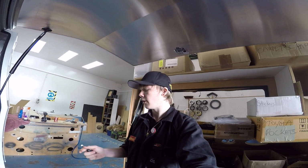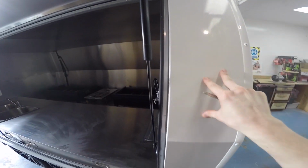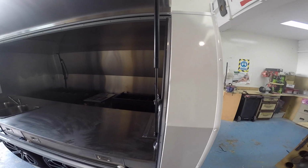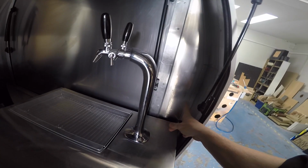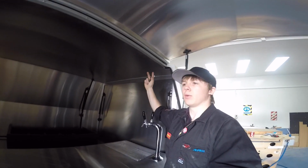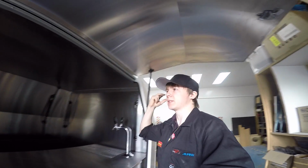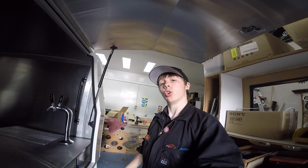And they have got their own ideas that they want us to do. So I'm going to figure out what's available, figure out what's going to be best for them, have a discussion with the customers. Their idea is to have two speakers on each of these four corners facing up like that, and a head unit of some kind over in this corner where they can control it. And I think an amplifier is probably going to be needed as well, since we're doing four speakers. My idea was to have the Rockford Fosgate Wake Cam speakers that are in their own pods hanging down from the roof about here, and I wanted to go for the big 8-inch ones with the horn tweeters because they'd be super loud. So one in each corner facing outwards. I thought that'd be quite cool, but I'm not sure.